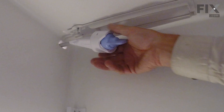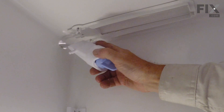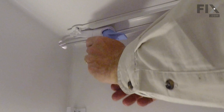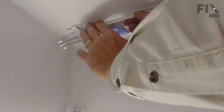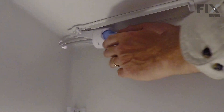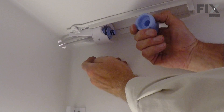We're back in the fresh food section. We're going to take that water head and make sure that we insert that round pin into the opening on the housing. Then reach in and snap the opposite side in so that it pivots freely. If we dislodge the housing in the ceiling, make sure that we snap that back into place. We can then remove that bypass plug to grasp the housing. Twist the plug out and retain that.